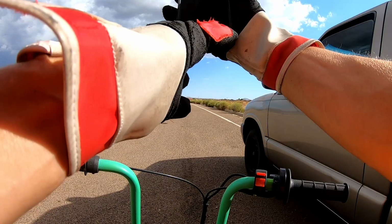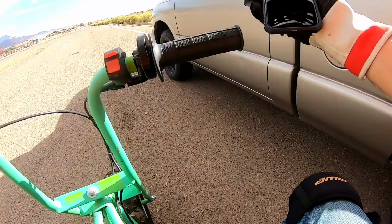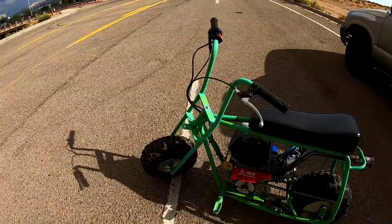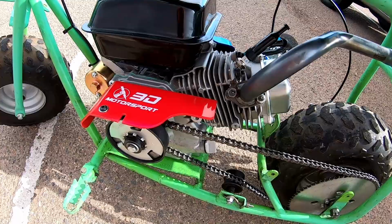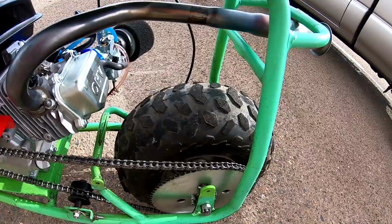She did 60 miles per hour even with an 18 tooth clutch. But that actually kind of tells me that that might be too much gear. If you look at the gear ratio calculator, it's only turning around 5,900 RPMs at that speed with an 18 tooth clutch and a 70 tooth rear with that tall of a tire. So that kind of shows me it's too much gear.